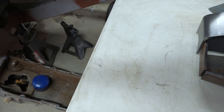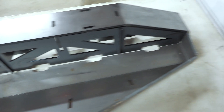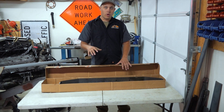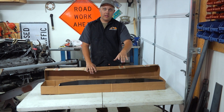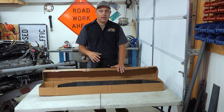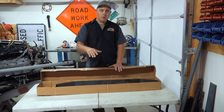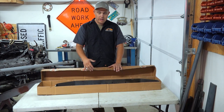Let's get into the first one here — I've got the Pro Series GM Dana 60 front axle truss. I really like this one. It's made out of quarter inch and 3/16 ultra 100 steel. Another thing that's really nice about it is they've designed the truss to sit as low as possible on top of the axle. If you're building a link suspension, which we are, that's important, as your link separation needs to be at certain amounts for how you design your suspension. This truss will allow you to keep that top link mount as low as possible, giving you the most freedom in how you design your suspension.